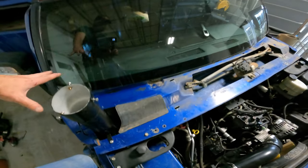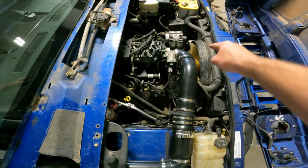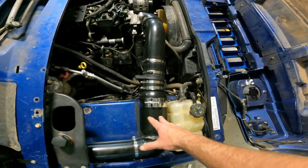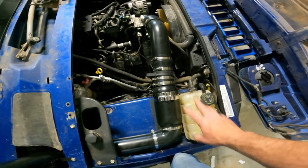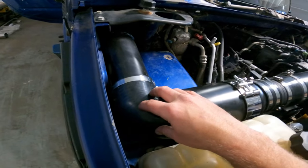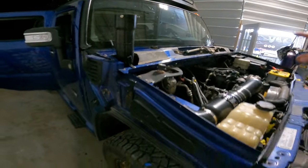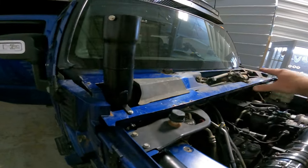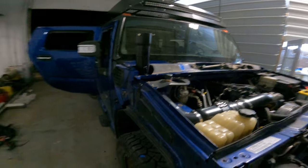Here's what it looks like with the cowl and everything off. I still need to put the windshield wipers back on and the cowl. As you can see, it's a really simple setup — we have a 90-degree coupler coming off the throttle body into the straight pipe with that 60-degree hump to get over the coolant hoses, then our MAF sensor, and then our Spectre air filter — a canister filter I got on Amazon. I saw a bunch of guys with V8s leaving reviews that they've used these and they work fine, and lots of guys with V6s and other exploring rigs are building snorkel kits with these too. Moving on, we have a second 90-degree elbow into our straight pipe with our bracket, and finally the snorkel intake tube with its bracket. All in all it's a really simple setup — anybody could do this. I'm going to put the cowl back on, get the pre-filter on top, and then we'll go over all of it again in the daytime, get some beauty shots, and I'll give you my overall impressions of the snorkel kit.